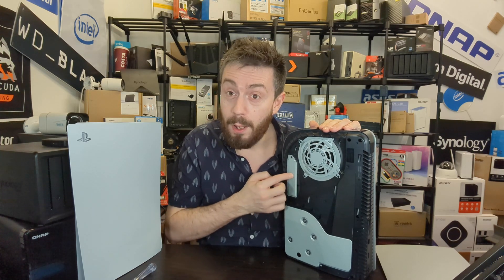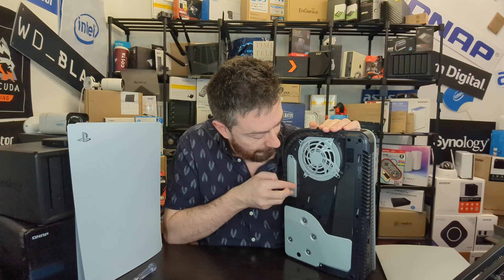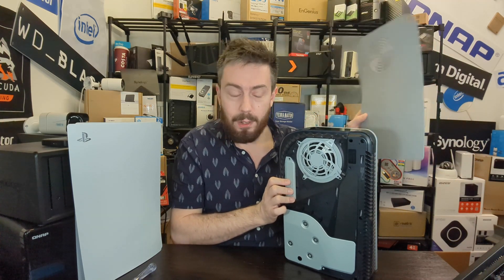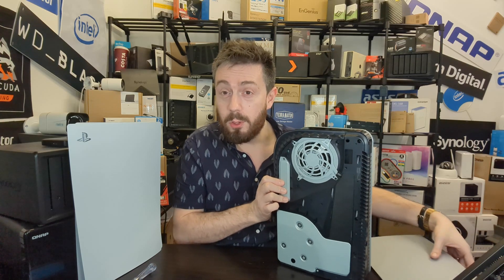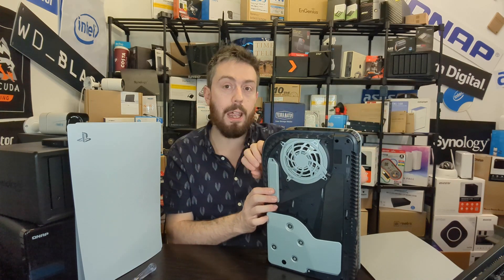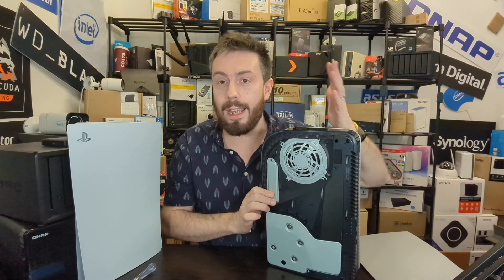I've never been as convinced, because as soon as you put the SSD in there and cover it over, the active airflow is little more than these tiny slits and there's no ventilation inside either — so you're encasing a hot block of metal under a bit of metal. The big thing for this video is the dbrand plates have got vents — that big old circle right there — so that introduces an unforeseen element of passive airflow working in conjunction with the active system.